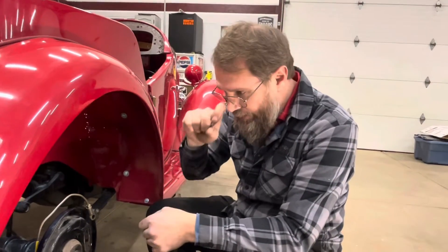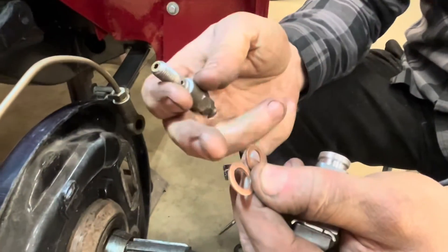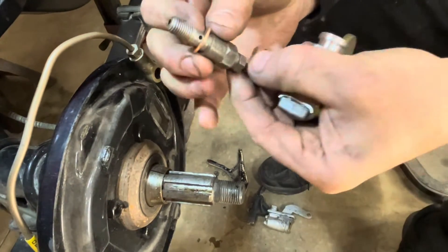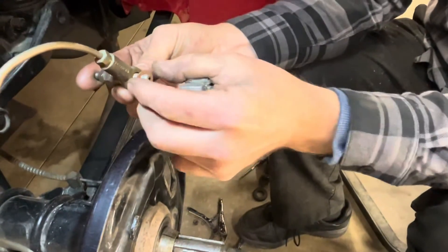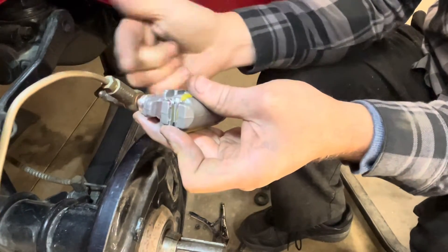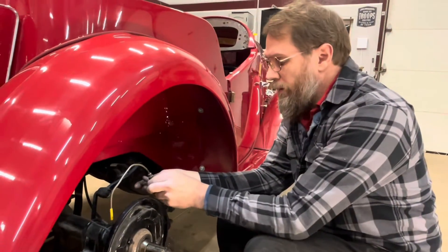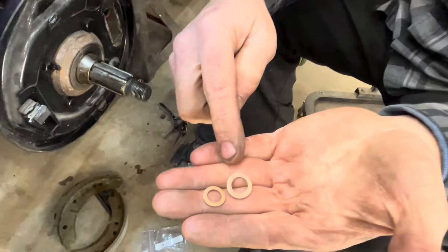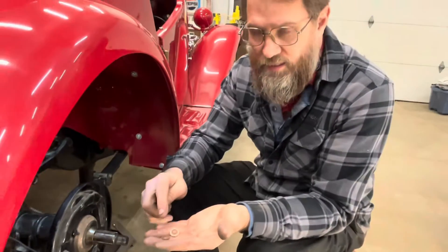Since it's hard to get the camera back in there, it's easier to show this out here. For the banjo bolt you have two different washers - one's larger and the other one's smaller. The larger one goes on first and sits over that step, then it goes through the banjo bolt with the smaller one on the other side, and then into the wheel cylinder, then you tighten it down. They only sell these for the TD as a full set, but these are the same washers used on MGB, MGA, and everything else - these two washer sizes are super common on these cars.